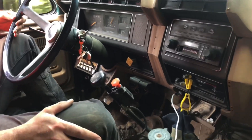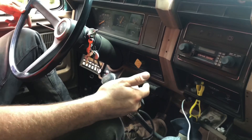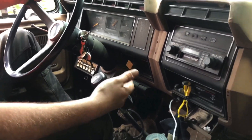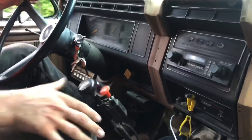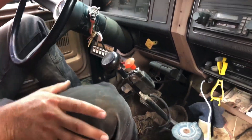When you get to the point where you want fourth high, you keep your foot on the gas, pull the shifter up, and then simultaneously let go of the gas pedal and push the clutch in. There's a click, and then you're back on the power.